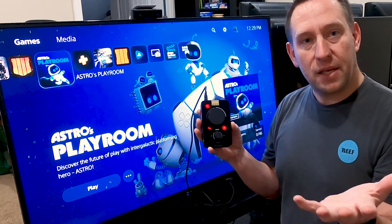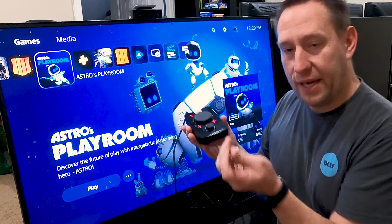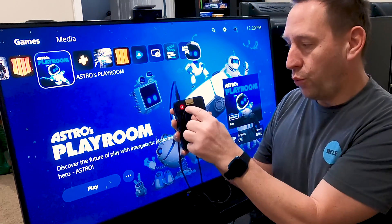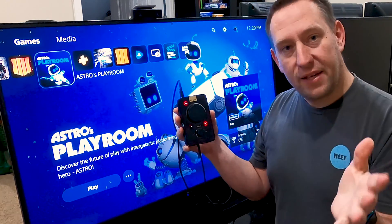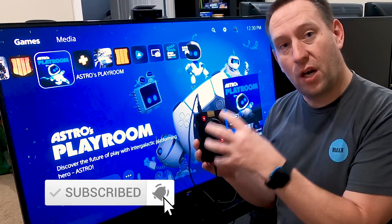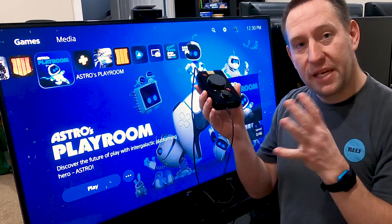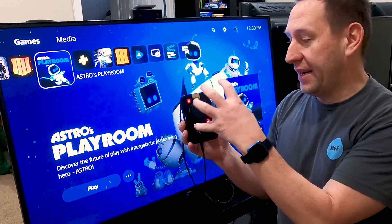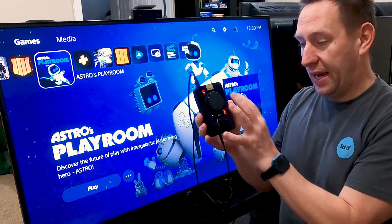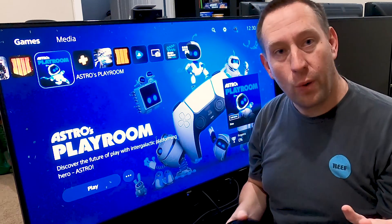We want to make sure that the light is working. If the light is coming on, the next step is to plug your headphones in. I've got the TR40s, and I'm going to plug the end in here. You'll notice immediately the lights switch to white on the inside. That tells me the headphones have connected successfully. If when you plug it in the light does not turn white, something is wrong with that cord specifically on the Mix Amp end — because I can have the headphones unplugged at the other end and it still goes white. It's detecting the cord itself and confirming it's connected.